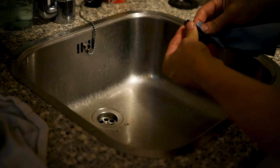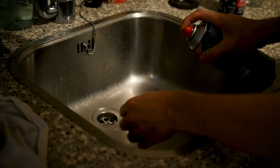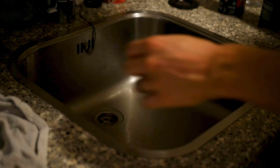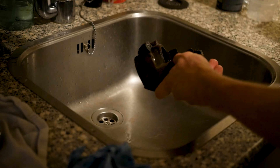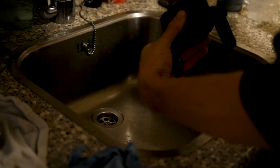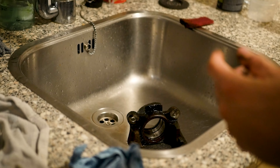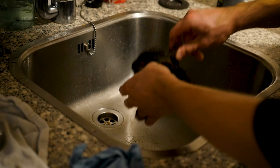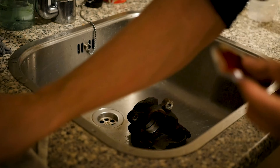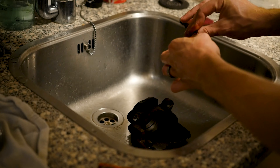Let's start from the very beginning where I refurbished my brake calipers. I got some new rubbers, some new o-rings, and some used pistons but in way better condition. The first thing that I did was clean them all up and then apply a generous coating of silicon spray before assembling the caliper itself. I then smothered the seals in silicon grease that I got with the seals themselves.